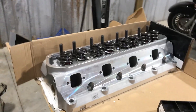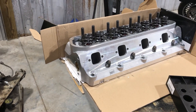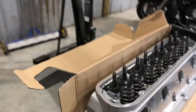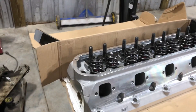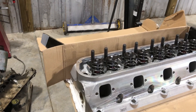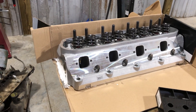So next thing I want to show you: these are the new heads. They're Speed Master heads — they're not very expensive. They're made for an adjustable rocker arm, which means I'll be able to adjust things a little better. It's not the best scenario, but it's a little better than having pedestal mount rocker arms to a degree. These are the heads I'm going to be using on this engine.